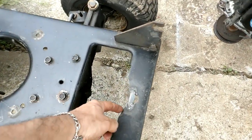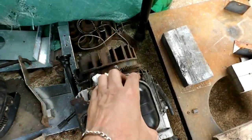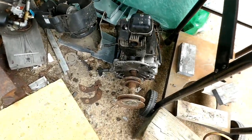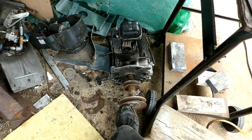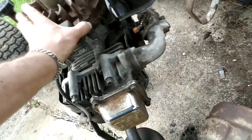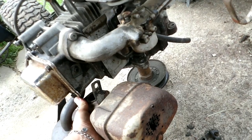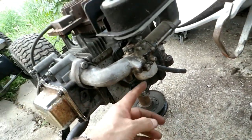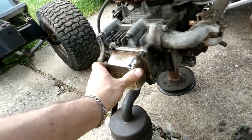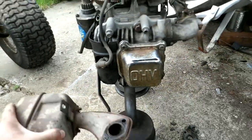I've had to do a little modification here for the muffler. This is a 12 horse that was originally on it, but it had an accident on the magneto mount - somebody broke it and stripped it - so I got the whole lawn mower for free. The pulleys are the same and pretty much everything. I'm borrowing the muffler off it because I never liked the muffler on mine. It came off the motor and sat basically almost underneath the carburetor, so when I got it going the carburetor kept dripping gas until I put a new seat in it - a pretty dangerous situation.